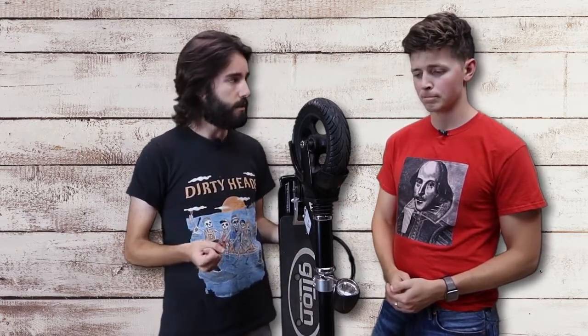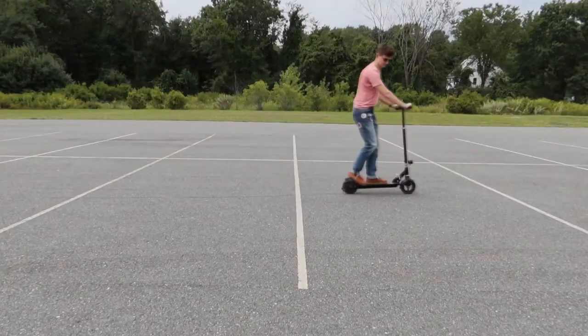There's no regenerative braking on this scooter. Regenerative braking is when you slow down using the brakes and it recharges the battery with the motor. Regenerative braking is great on something like an electric car, but on something so small there's not a lot of kinetic energy to regain. For example, if you took the entire 15-mile range of this scooter and stopped full stop every minute, you'd get about one more minute of riding at the end — which is nothing. Adding all the extra components and complexity just isn't worth it.